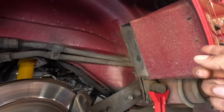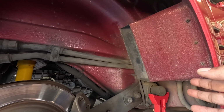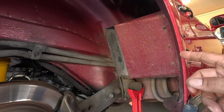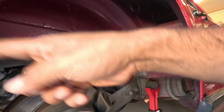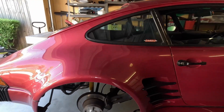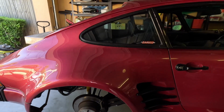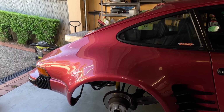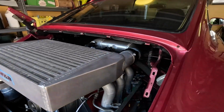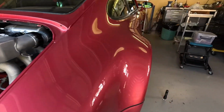So yeah, the thermostat's closed when the oil is cold, and when the oil gets hot, the thermostat opens, and now the oil is flowing from the front of the car all the way down. So we have oil circulating through the entire system when the oil is at full temperature. And that's the only time when you can actually check your oil level and be confident of getting an accurate reading of the level of oil in the entire oil system.